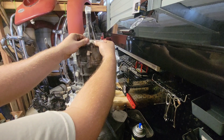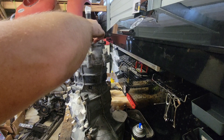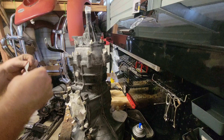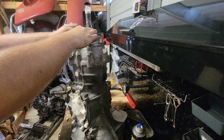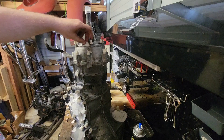I'm just going to show y'all how to tape all these fasteners off. You just want to wrap it around about two or three times on each nut, and some of them are hard to get to. What I'll do is take my little pick with a 90-degree bend on it and use that to pull the tape around the edges or crevices — whatever I'm dealing with. If you tape all the way around it, just pinch the top and it'll cover the stud up and protect the threads for you.